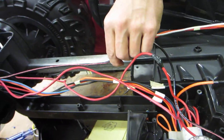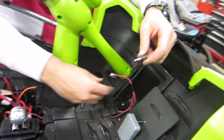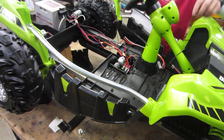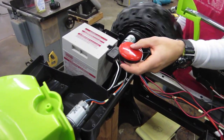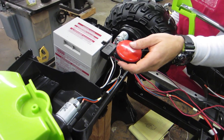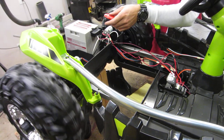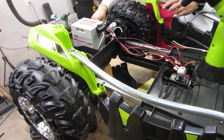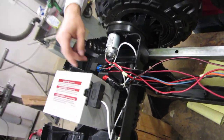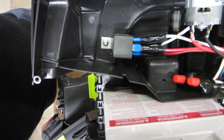That's spliced up and goes into the negative — that is the entire layout of this system. You should now be able to use any jack and any switch. As I press this now, the gears should still work, and switching into reverse works as well. We're able to do that because the relay closes the switch magnetically, so the high 12-volt battery which was burning out the low voltage switches is no longer an issue — we're using a 40 amp automotive relay. And that's how it's done.